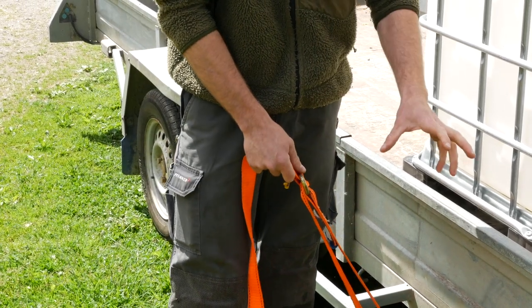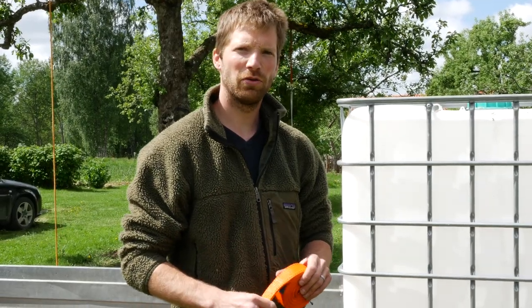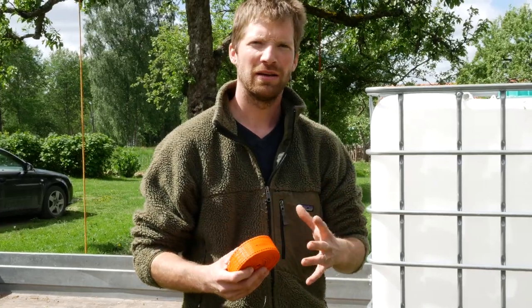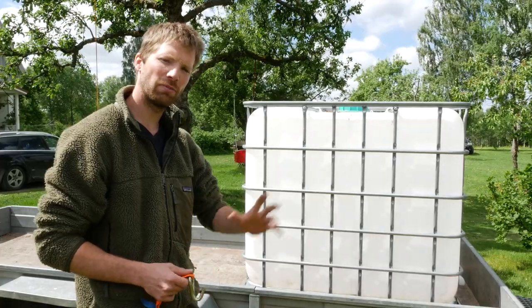The best thing is if you have a hook or an eyelet on your trailer to hook it onto. When it comes to picking the right size strap for your application, keep in mind that when securing a load it's not just the weight of the load itself — if you were to brake, that weight will develop a much higher force than its own weight.